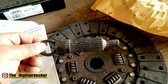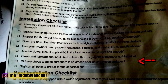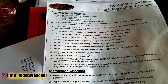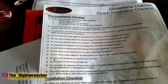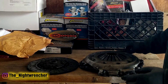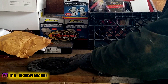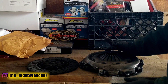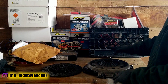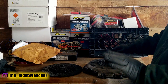You're going to want to lubricate the pilot tool a little bit before you use it. According to the paperwork that Center Force supplies, you want to use dry graphite lubricant or nothing at all. I personally like to lubricate the splines because it makes it easier to install everything, but if you're not going to use the right lubricant, don't lube anything. You're going to take your alignment tool and the pressure plate, and try to maintain a clean surface on both the clutch disc and the pressure plate — don't get grease or oil on it. Try to keep it as clean as possible.